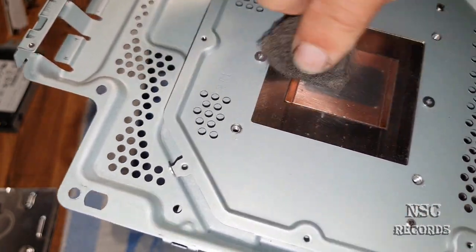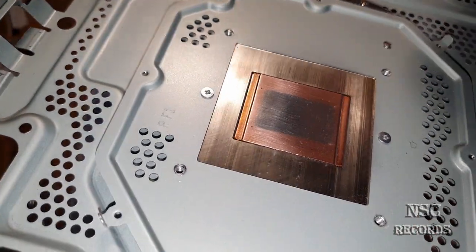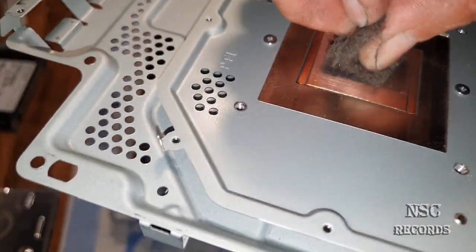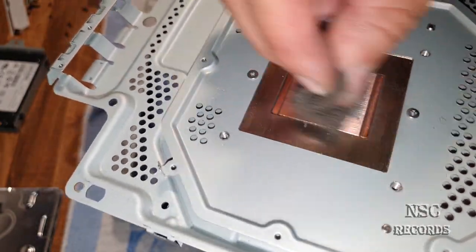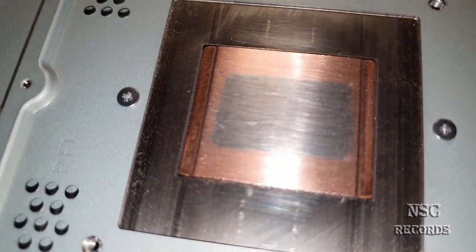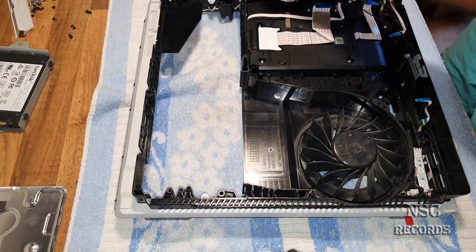I can see already nearly the copper - the color from the copper is getting visible now. I have shown you this also on another video - you should lap it here, and you can see again the color from the copper. The rest I'm going to finish alone because this is going to take a little bit of time. But I just wanted to show you now - look, it's nice again, see that. This is just enough. You can now go ahead and apply your thermal paste again.